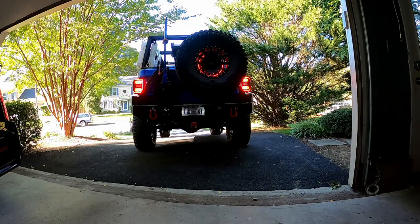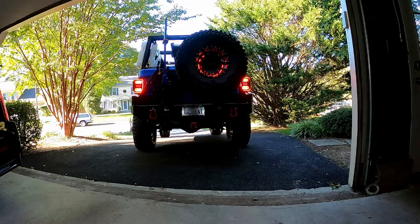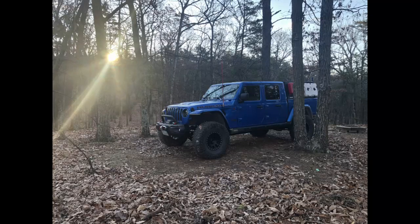This is a brief video of when I first installed the third brake light option. This is something that I got from Quadratech for a JK, and it works really well. We discussed doing chase lights with a third brake light integrated, but my girlfriend really liked this option. I still may go with a chase light later, but this works really good, keeps me in good standing with DOT. So I just ran the wiring down from the plate along the arm. I could have spliced it into the brake light, but I had the tailgate off anyways for the bumper install, so I ran it in through the bumper and attached it directly to the third brake light. So it works great. I highly like it. I list the parts down below that I purchased.